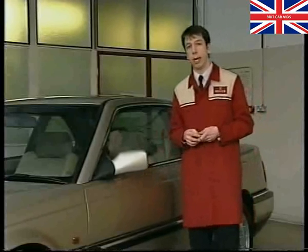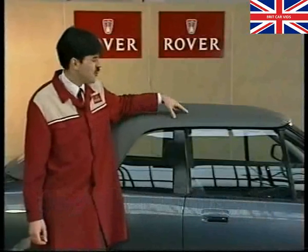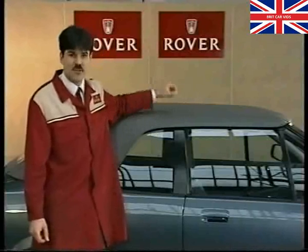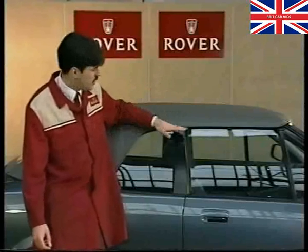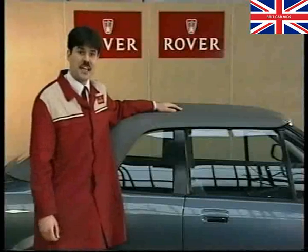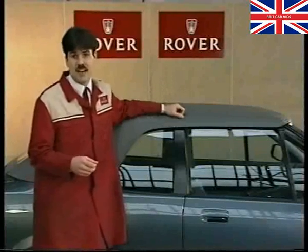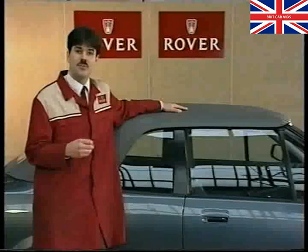Now let's have a quick look at the Rover 200 Cabriolet. Casting your mind back to the last edition of Technician's Update, we introduced the Rover 200 Cabriolet, took you through how the hood was actually built up, and also highlighted a few repairs that you can carry out. No real problems to report since, except to say that one of the fixes we highlighted in the video and in the repair manual is flawed. We told you to immobilise loose rivet heads that can become trapped in the hood frame during certain repairs — replacement of the headlining for instance — by injecting body sealing wax into the hood frame spars. On reflection, not a good idea. Long-term tests found that particularly if the hood frame spars are overloaded with wax, in hot weather that wax can liquefy and seep out, contaminating the headlining. There's a viewdata bulletin out at the moment telling you under no circumstances to inject wax into the hood frame, and the repair manual information will be updated in due course.